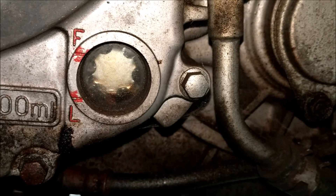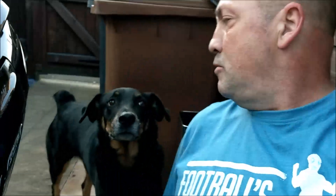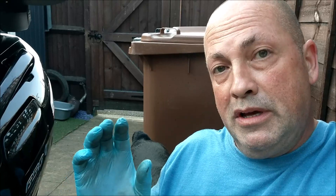The coolant - that's a completely different kettle of fish, so we'll do that another day. The engine has been running for about 30 seconds and that oil disappeared from the window straight away. Now the engine's off it's starting to settle back down - I'm going to give that a good five minutes before I start adding or subtracting fluids. When I ride it and decelerate, I know it's got good engine braking because it's a parallel twin 650. But it seemed to be too good - it seemed too bad. So I tried to spin the rear wheel and it wouldn't hardly spin, I had to proper give it some beans.